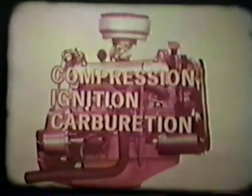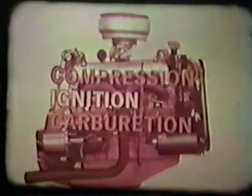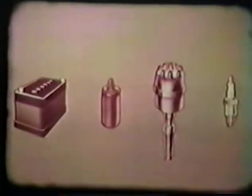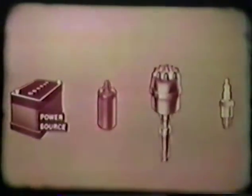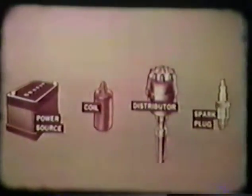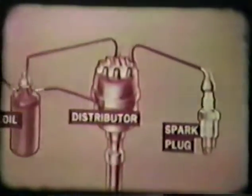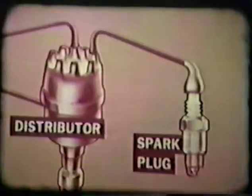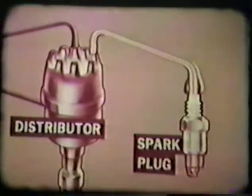The next factor to be considered during tune-up is the engine's ignition. Whether of conventional or transistor design, all components of an engine's ignition system must function properly for satisfactory and economical operation. Basically, this system consists of a source of power — either a battery or generator — ignition coil, distributor, spark plugs, and associated wiring. During tune-up, your primary concern is the distributor. It must be tested and adjusted if necessary to make sure it is sending ignition voltage of the proper intensity to the spark plugs and sending it at the right time.